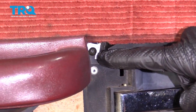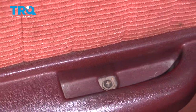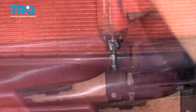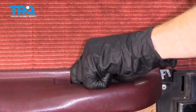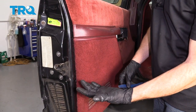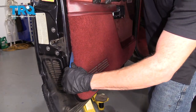You're going to find one Phillips head screw right here, and then the other one's going to be located up inside the door handle. Remove the pair. Once you have both those screws out of there, let's continue on with our plastic trim tool and we're going to start removing the door panel from the door itself.